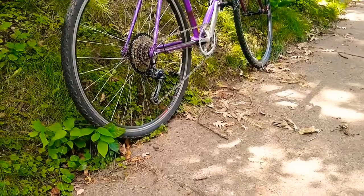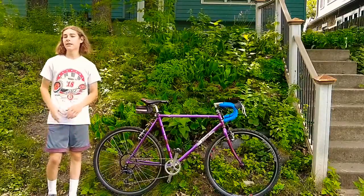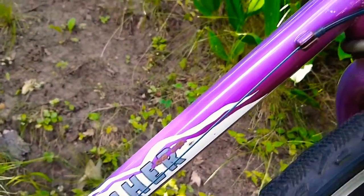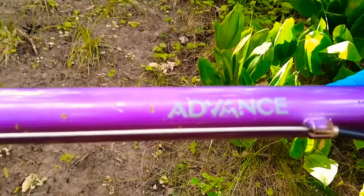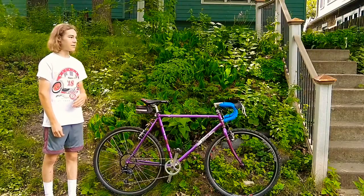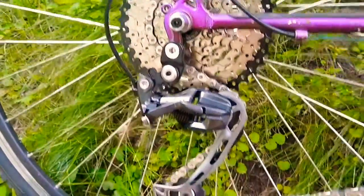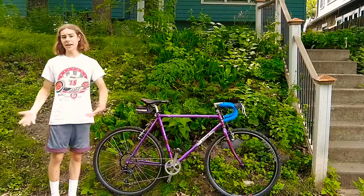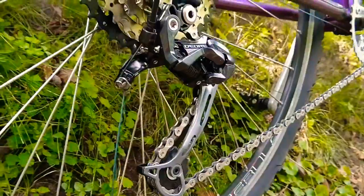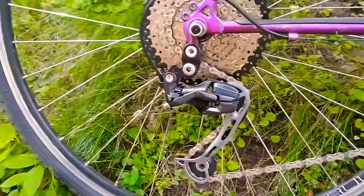The first and biggest change is the derailleur. The bike originally had a mountain LX, which was factory to the Fisher from around 1989. I wanted to keep it because it was cool and vintage and in pretty good condition, but since I was running an 11 to 42 tooth wide range eight-speed cassette, the mountain LX just couldn't handle that range — it wasn't designed for it. So I settled for getting a Deore nine-speed derailleur, which can also do eight.